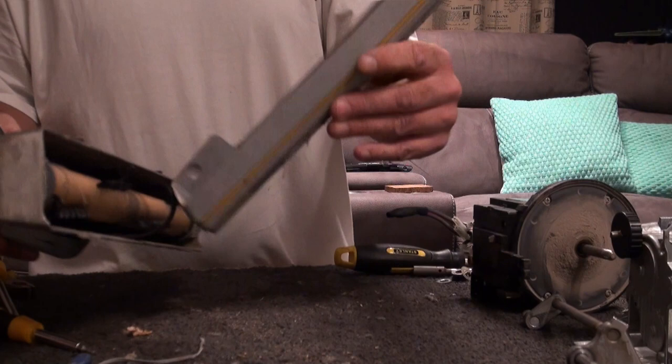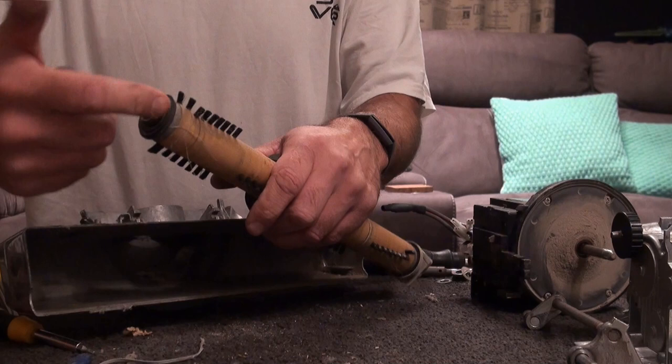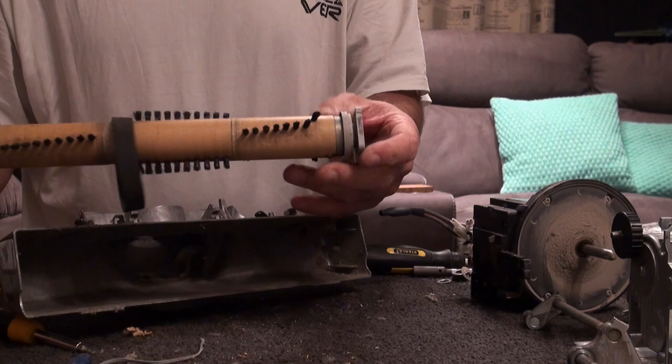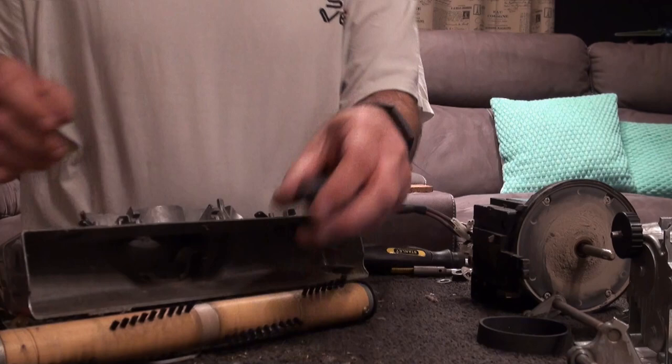Take the brush out. Now these come off and you tend to get bits of fluff from that around there and debris, so we're going to clean all that, clean all inside there. Always these bearings get gobbed up. We're going to give this a scrub, so again, just take those off. Those go to wash. I'll wash and scrub this. We'll see how that belt's doing. We'll check on that belt. If not, we'll fit a new belt.